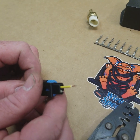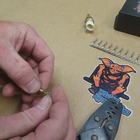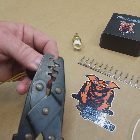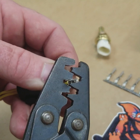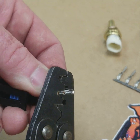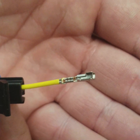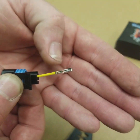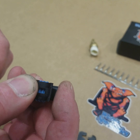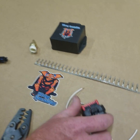This coolant temperature sensor is a forward feed connector, so what I did is inserted the wire into the rear of it already and stripped it. We're going to go ahead and crimp it, and then we're going to pull it back into the connector. This connector has to be assembled this way — the terminals will not go in from the back side. We'll start with a larger size, which sometimes makes it a little bit easier to prevent the pin from rolling sideways. As you can see, we've got a pretty clean crimp — nice and even. We've got the copper strands as the conductor in the primary crimp, and the insulation in the secondary crimp, which is our strain relief. We'll go ahead and pull this into the connector. Now that it's inserted, this one is done and we'll move on to the connector that actually goes to the CAN box itself.